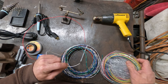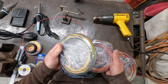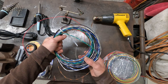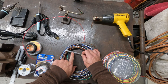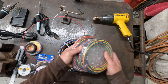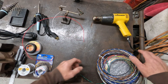I just smashed it — it did not distort. So there's the difference between cheap wire and GXL/TXL series wires. I highly recommend them; I've used them in multiple builds and it's really good stuff. It's much more expensive than cheaper wire, but you only have to build your wiring harness once. I buy 25-foot rolls and label them so I know what sizes I have. This extra roll is for the FJ project.